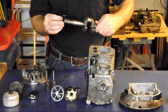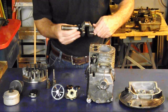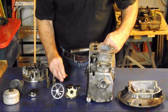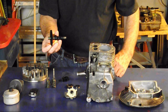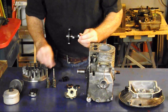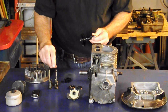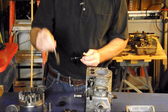Then we have a gear that fits on our crankshaft — like so — and that turns our camshaft. The camshaft, as it spins, is going to be lifting up our valve lifters on these lobes. And as they do that, they'll be compressing and releasing these springs, opening our valves.